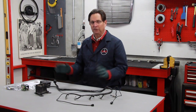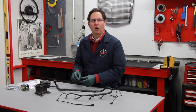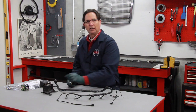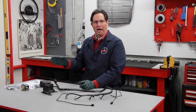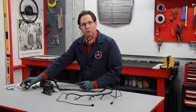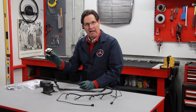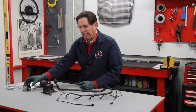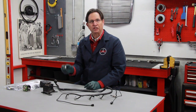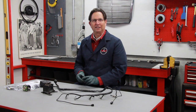You may be thinking, what is this override kit? The reason I call it an override is because you're literally overriding this relay. You're putting another system in the car that bypasses the car's electrical system. It takes power directly from the battery, routes it through to a new high-amperage relay solenoid, and allows you to use a push button — mountable anywhere on your dash — to control your pre-glow circuit.